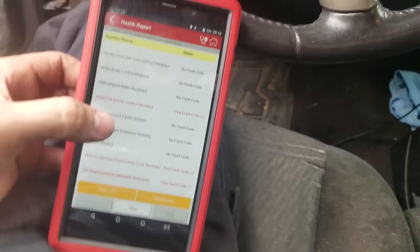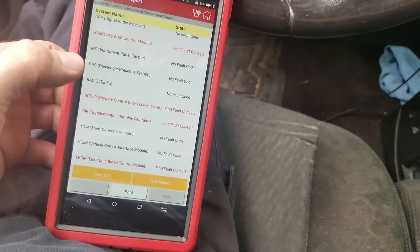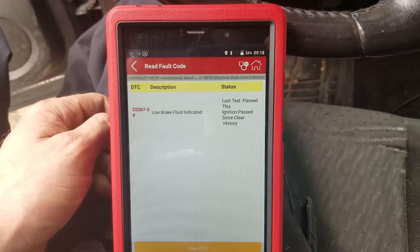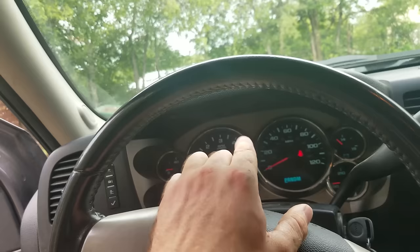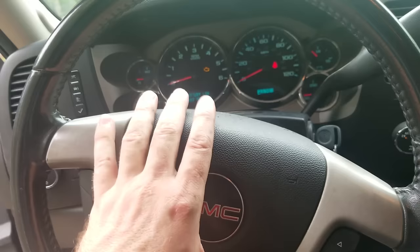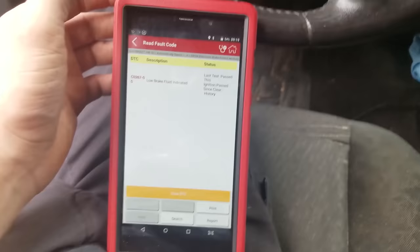The electronic brake controller module has a fault code: DTC — low brake fluid. That's what I thought. These trucks have a brake fluid sensor on the master cylinder. When your brakes wear down, the fluid level drops in the reservoir and it starts flagging a sporadic brake code. I'm going to check the fronts to see where the pads are, then look at the backs. I don't know the mileage so I'll check the whole brake system front and rear.